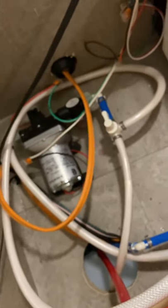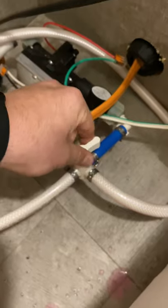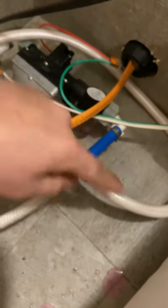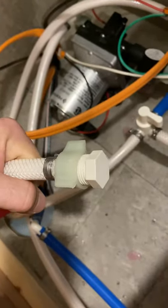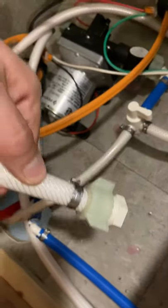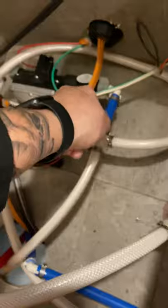Back there is your water pump — I'm going to climb in here to give you a better view. There's your water pump, and Grand Design has already been awesome because they installed this bypass. You turn this to the bypass position — this hose is pre-installed by Grand Design. You pull that plug out, cut the top off your gallon of antifreeze, set your gallon right here, shove this hose in the gallon, and turn the water pump on. It sucks all the antifreeze into your water lines.